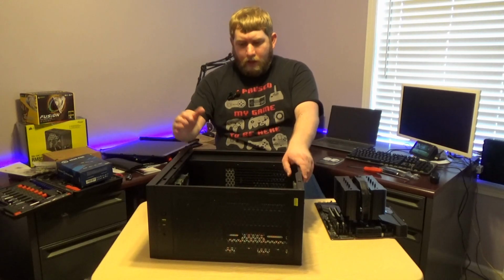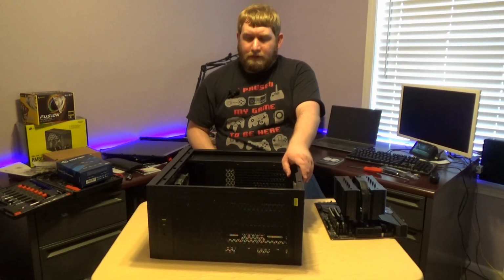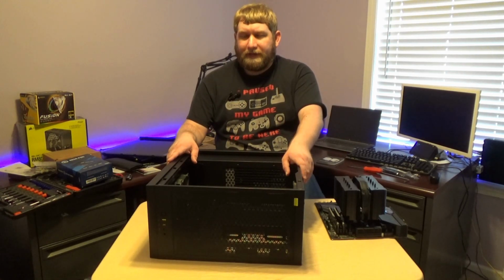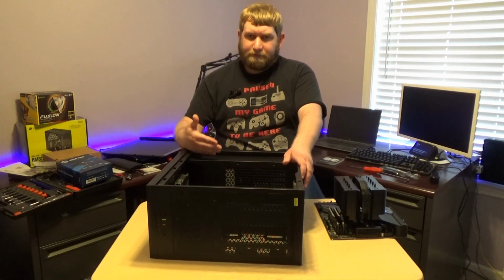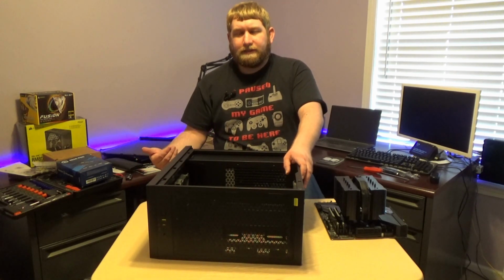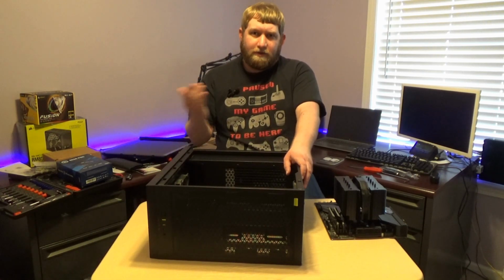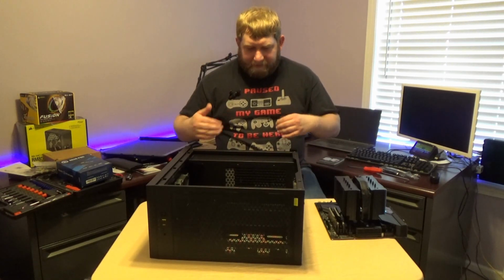I'm not really sure. I want to make sure that when I get done with this, I have a positive pressure. So I'm going to have to probably just load up with fans, hope for the best, and if it seems that I've got a negative, not a positive, when I start to see dust build up and stuff, I may make some changes. Next time I get a case, I'll probably get one that has potential for fans at the back and the front for more pressure. But I'm stalling. I'm excited.